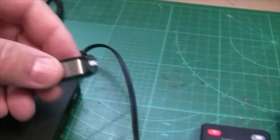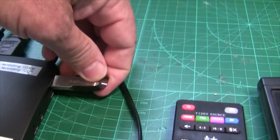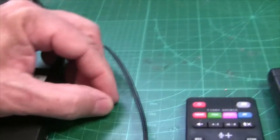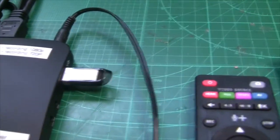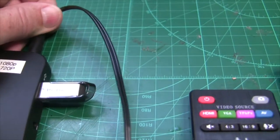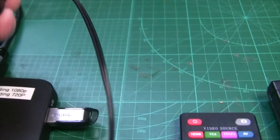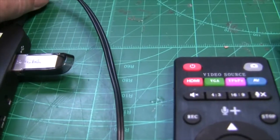The only other thing you have plugged in is your thumb drive. I have a 64-gigabyte thumb drive — generally it's about nine gigabytes of video for a two-hour tape at 720p and a 4:3 aspect ratio.